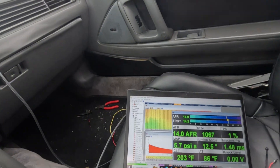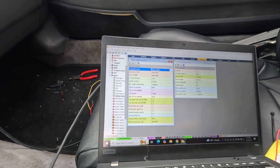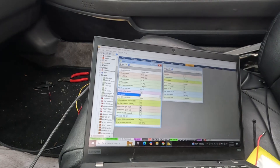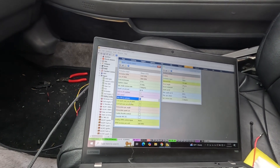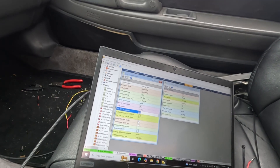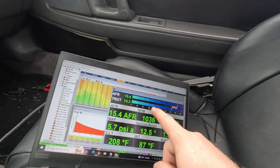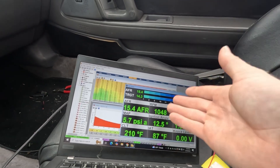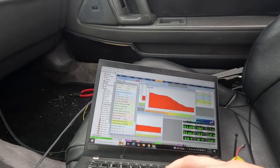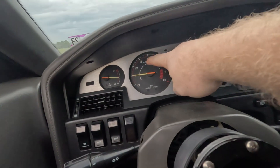Let me show you my settings real quick. We've got launch control — as soon as I turn it on, always active. We're going to trigger it based on the vehicle speed sensor, which is currently set to nine. I think I'll turn that down to about seven miles per hour. Minimum TPS to activate — we want at least 50% throttle. These are pretty much the standard settings from ECU Master: basically 25 degrees of ignition retard, and fuel enrichment is 35%. My oxygen sensor is currently cooked and the one I ordered is a 4.9 instead of an LSU 4.2, so unfortunately we're kind of guessing on air/fuels. We've got 35% fuel being added into the mix. It should go up to about 3,500 RPM and start cutting.